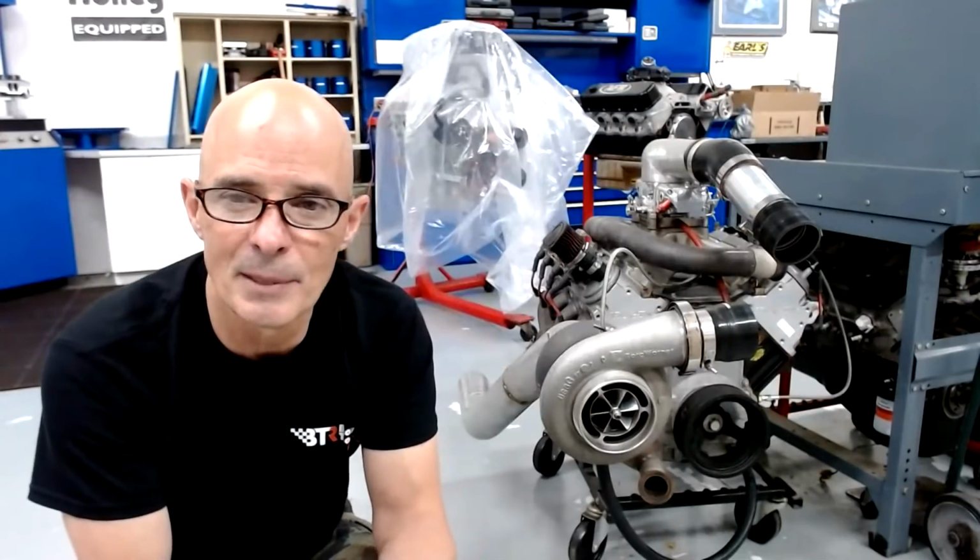Well, trying to maximize VE in a Honda F20C with a GT3582 at 20 psi, I gain VE by ceramic coating the pistons, low tension rings, crankcase ventilation, quench, welding the combustion chamber, ER7s. All of that should be good stuff, but did you compare it back to back from what it was before at the same boost and air fuel and timing and temperature and all that stuff? The ceramic coating of pistons should help keep some of the heat in there.